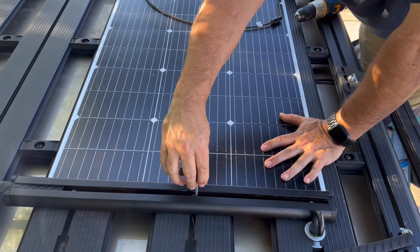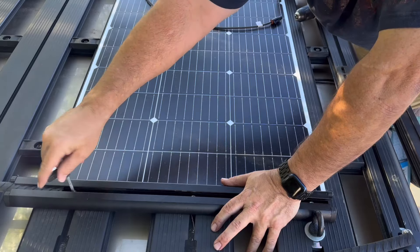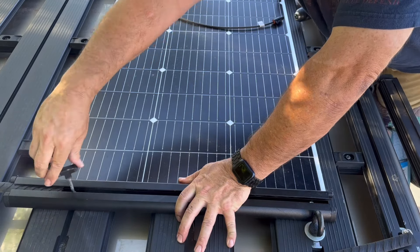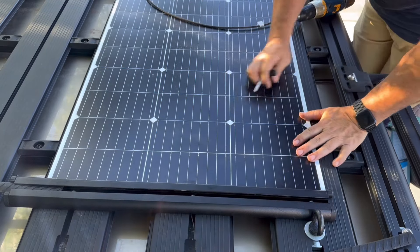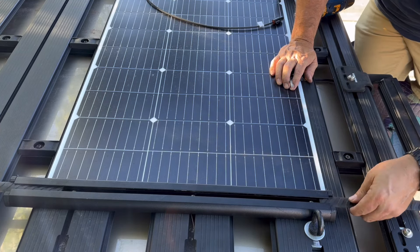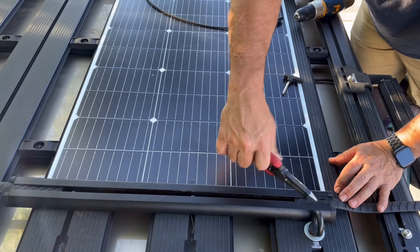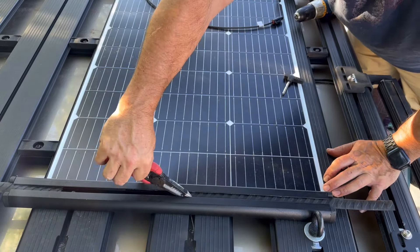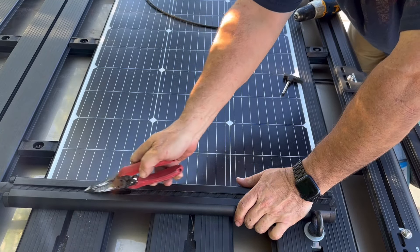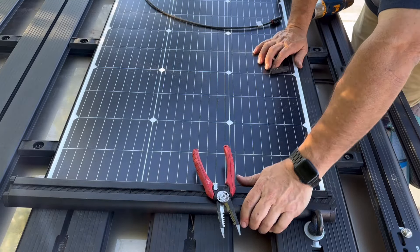Using that line there, I'm just going to snug these down along the top. Now this little trim that goes in here is really just to help quiet everything down — the fewer gaps and spaces for wind to whistle through the better. It won't add any weatherproofing, but it will definitely reduce wind noise and whistling. Okay, that part's done.